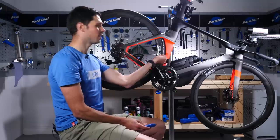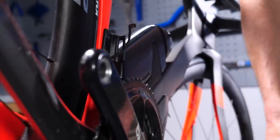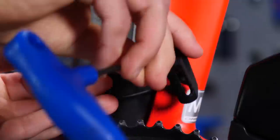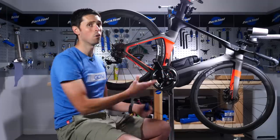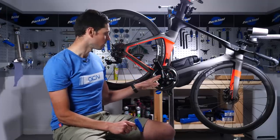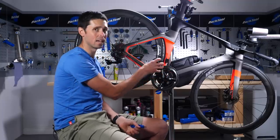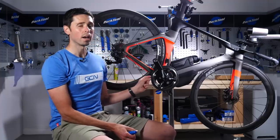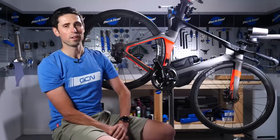With the front derailleur out of the way, we're left with the cable and bracket on the frame. I can simply undo the two 3mm bolts that hold it on, tuck it to the side, and refit those screws back in to block up the holes. That leads us to the next stage: removing the chainset. All bikes have slightly different chainsets, so when getting your 1x-specific chainring, make sure it will fit your crank — some have four bolts, some five. Also check at the time of ordering whether you need specific chainring bolts, and if so, order those at the same time.